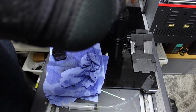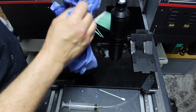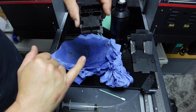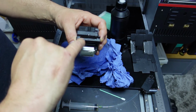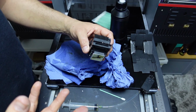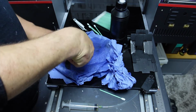So, yeah, I think really that pretty much covers it. Just be mindful not to get any of the ink on those cables, because of the orientation, that's your front of your machine, and your cables go in there. And if you get water or anything in there, ink, that will sit there wet for some time, because if you think about it, this ink is only curable by UV light. So if it's not in direct sunlight and you have not got your lamp on it, it's going to sit there and it will kill the whole thing. So keep that in mind as well.